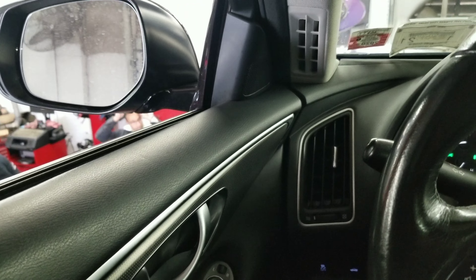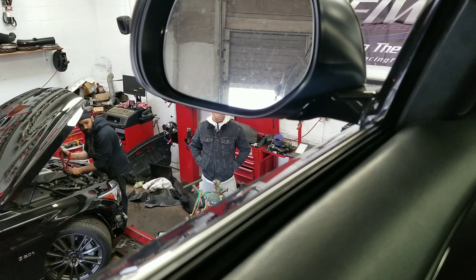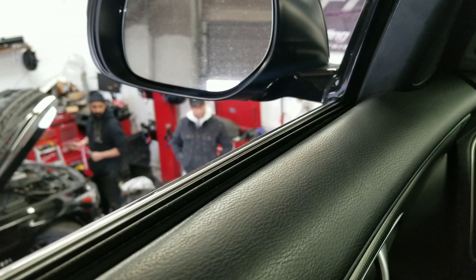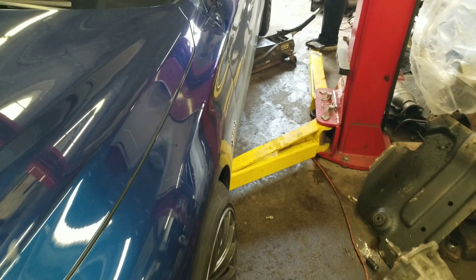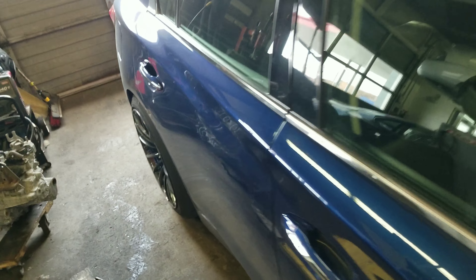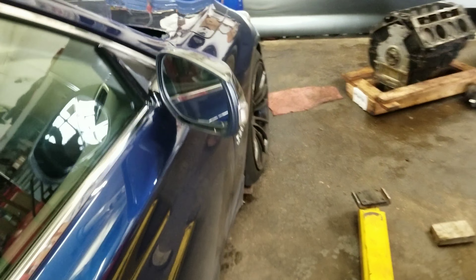I'm going to give it some revs to increase oil pressure. He let the car run for about 10 minutes, gave it some revs, let the oil pressure get up. He used brake cleaner on all the fittings and nothing is leaking. So yes, I saved myself from replacing any turbos. I need to get this dent out of the car — this car needs love and attention.